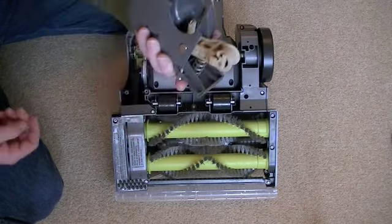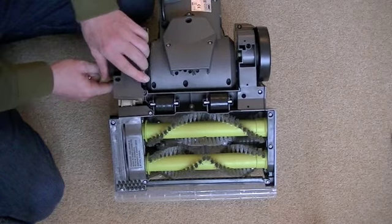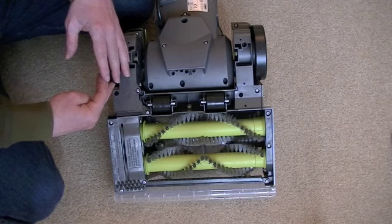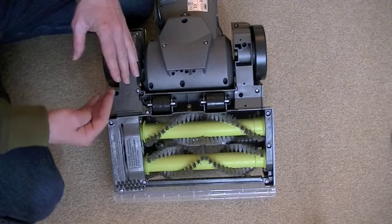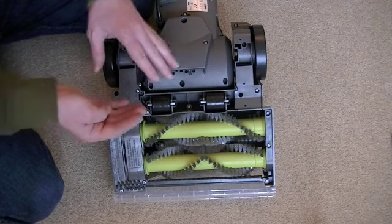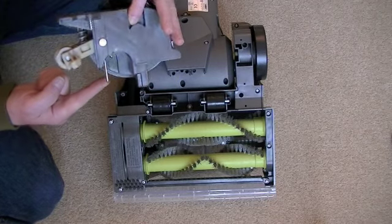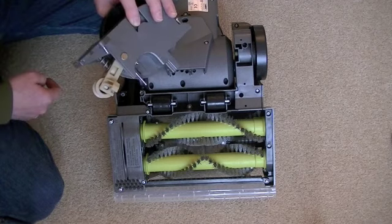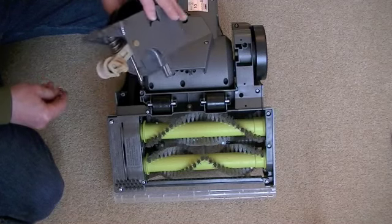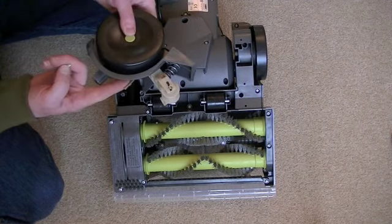This very small part plays a major role in keeping the belt in position. When it's in place it just stops the belt from moving on the pulley — which is what the problem was. The belt shifted too far on the pulley, started rubbing against the side, and basically jarred. The pulley didn't keep going, it melted, and that's what caused the problem. So as long as yours has got this metal spindle, you should be fine. That difference gave me confidence that this machine is not going to fail in the same way as the first one.